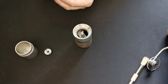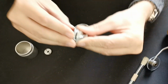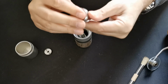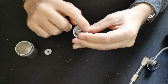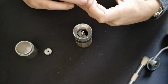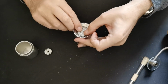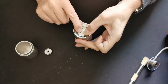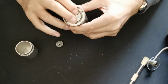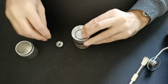Then you might find it easier to get this on. Now, I found in this grinder it fits one way better than the other, and they're up, that's snapped on. That's the scale onto the bottom of the burr, and then we line up the square hole with the square shaft best we can by getting that on. And you can see I can push that down, and that's lined up through there. Hold that down with my fingers, and I'll do it this way so you can see.